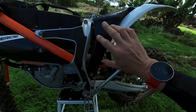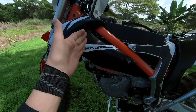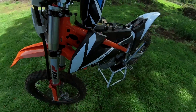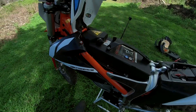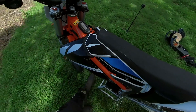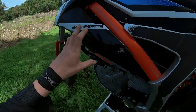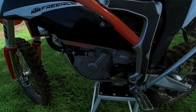All the plastic and back-end stuff is very easy to take on and off. The bike is water cooled — going back up to the front, it has these two tiny little radiators. I don't think there's a huge overheating problem, but check the fluid from time to time. It's got a little tiny cap on it like the 85s or 690s. It is a pressurized cap — I believe 1.2 bar or something, don't quote me on that. They are water cooled and the water pump does run when the accessories are turned on.